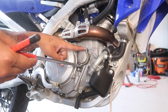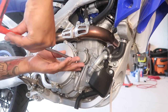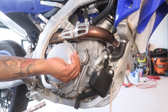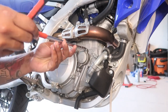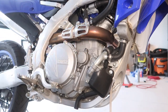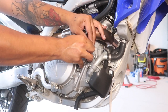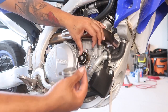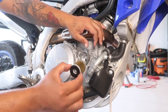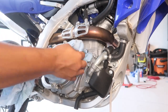We're going to take off the oil filter cover — these bolts are 8 millimeters right here. If you don't already have this tool, it is the best investment you could make for bikes. Go ahead and take off the first bolt, then the second one. It's supposed to be pretty tight so don't be scared. Here's the oil filter right here.